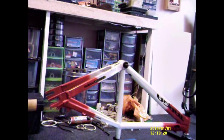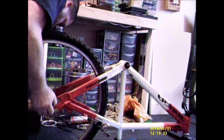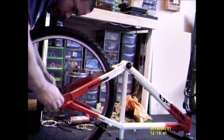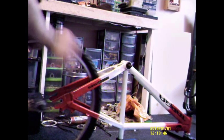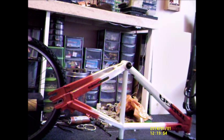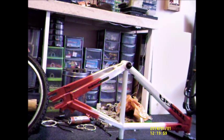Give me a little bit of extra room. I don't want to bolt the back one in too tight because I'll have to adjust it when I sort the chain. Yeah, that's got to go in there. Oh, that's much better. In fact, I've got a big old space this side. I just thought I want to get the sprocket in line as much as possible, don't I?